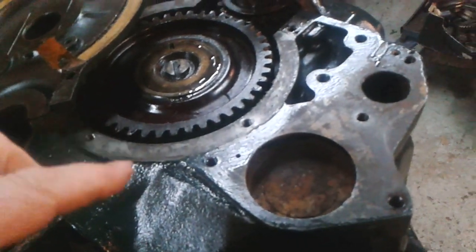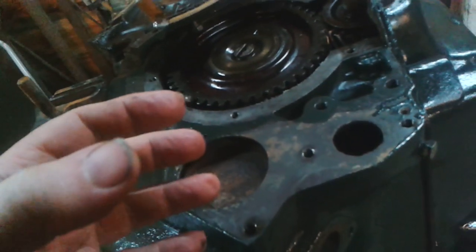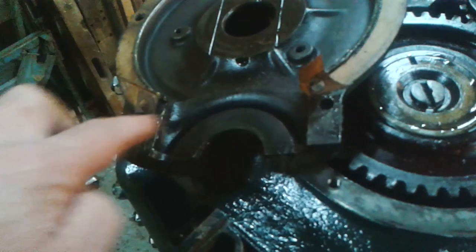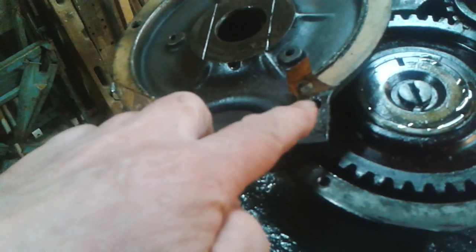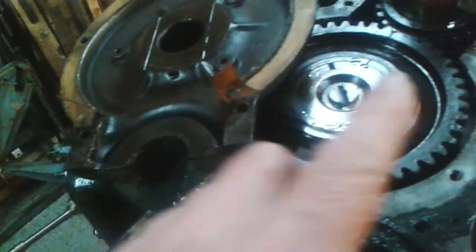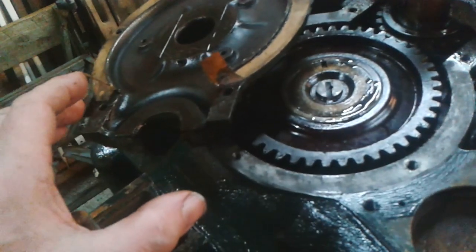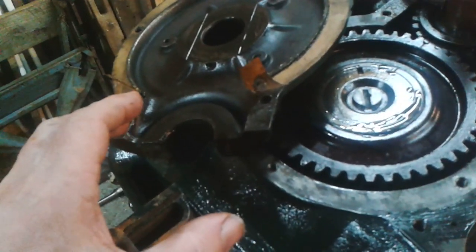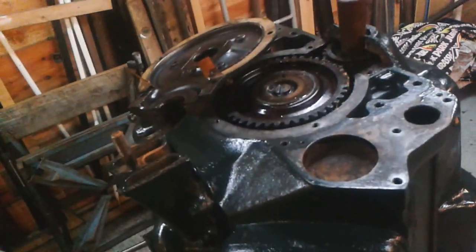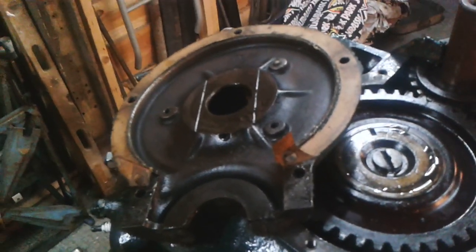And so I thought, oh, I'll just have a quick look. I haven't really come out to do a job. And not only had it folded back, it'd done it on both sides. So it just shows, doesn't it, how you need to be careful. And I think the reason was because I had the pulley in place. And I went in like that. So there's a little thing to look out for. Okay, I'm going to straighten those out and put it back on.